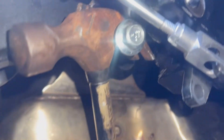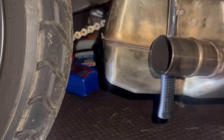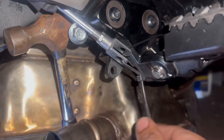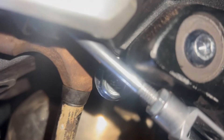Current predicament: got a 23mm bolt to take this whole rear set off so I can get this bolt out. A 23mm will not fit on there. Next thing — there's some Allen bolts in there, two of them. I'll take this set off that this bolt's holding, like the bracket, but I can't reach in there and get it. So I took the brake bracket off, zip-tied it right here, and now it's almost cleared. I'll just bend this a little more — it's the only thing I can think of to get it out.